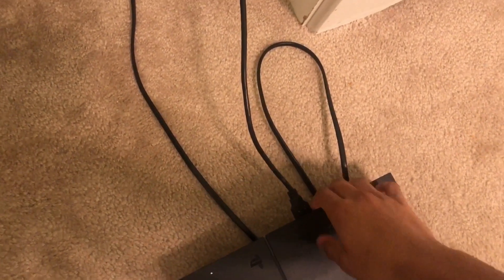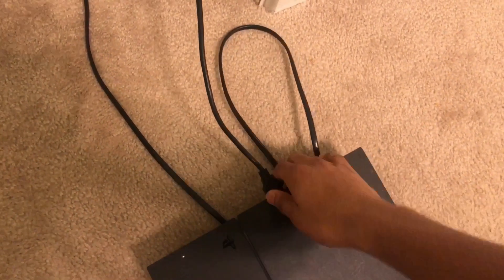This is the second step. You may be thinking something is wrong with your HDMI socket on your PS4, but that may not be the case. What may be the problem is something is wrong with one of your HDMI ports on your TV. So what you could do is go through each HDMI and change the channel to that HDMI to see which one works and which one does not.